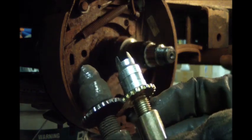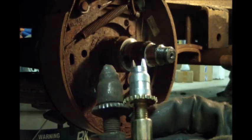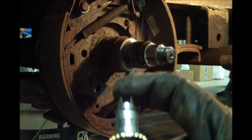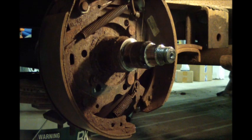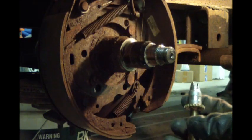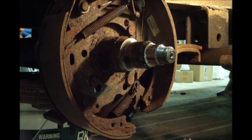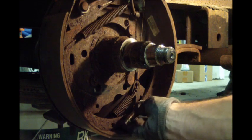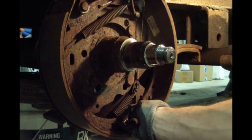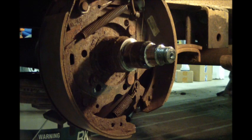I'll hold the two together. They're close. And this little notch is just slightly narrower. So I was debating whether I could open up the notch with a grinder or a mill. Or as thick as these brakes are, all this does is hold the pad apart there so that the tension's basically right on them. And I mean, I'm literally about a 1/16 off of this thing going on.